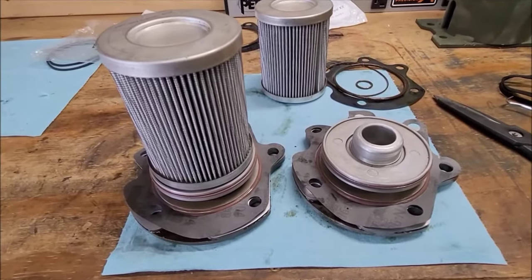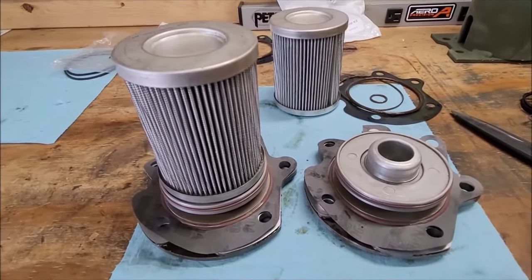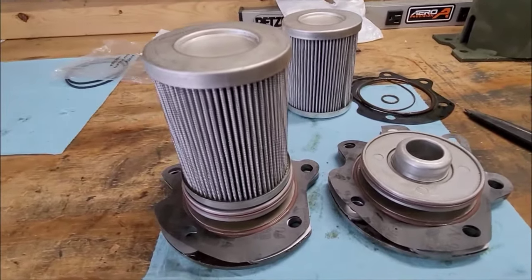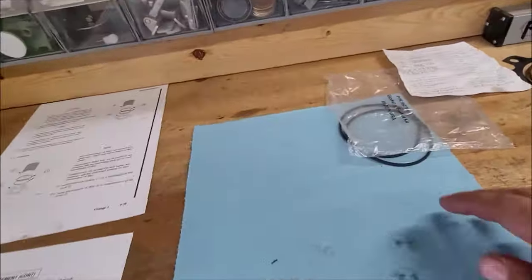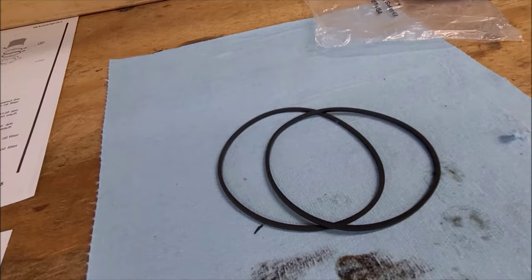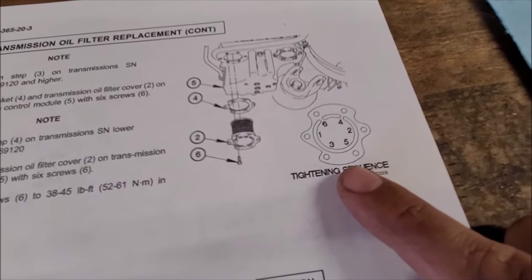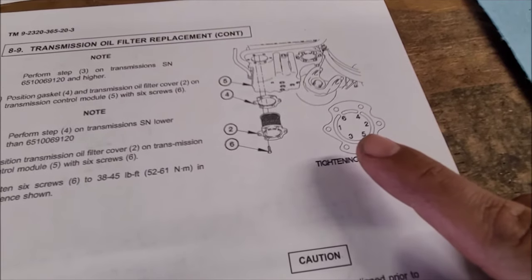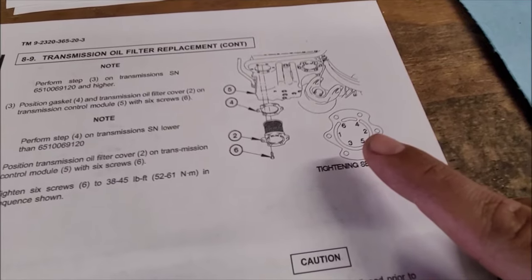I got all these pieces off, cleaned them up, and put the new gaskets on — it's pretty easy to match them up. On the driver's side near the shaft, I'm leaving the filter off because you need to put that on after you get it past the drive shaft unless you decided to remove the shaft. In the kit, these two squarish gaskets are not used in this application and the TM doesn't say anything about them either. There is a pattern of tightening them up — looking at it from the bottom, the torque is 38 to 45 foot-pounds.